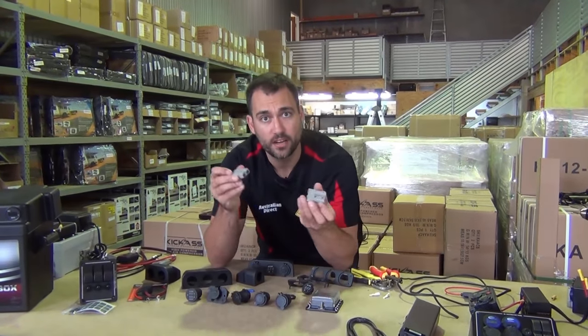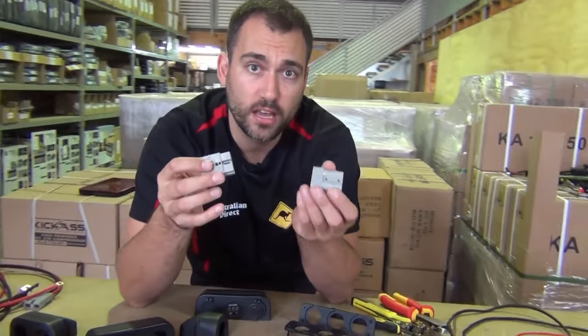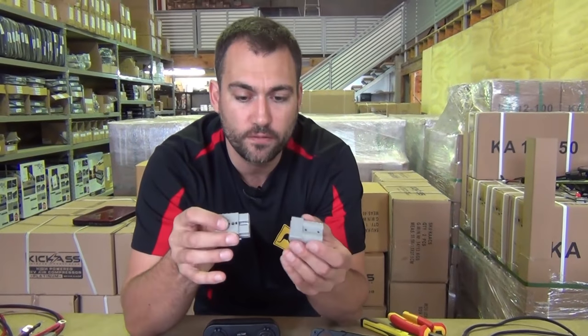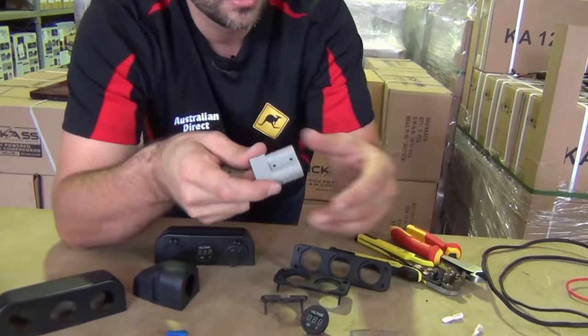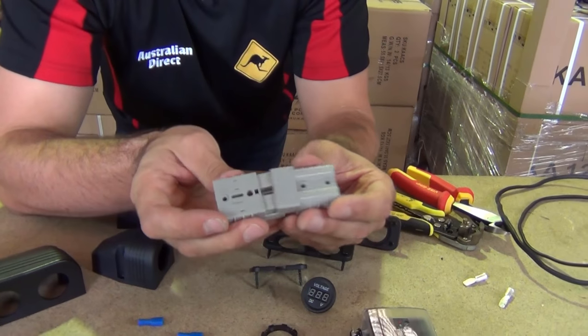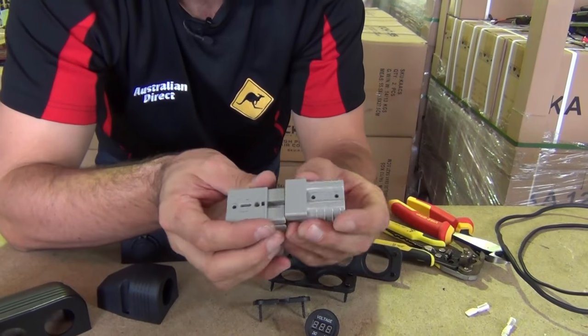I think all of you know Anderson plugs. Anderson plugs are my favorite connector in the world, and there's no male, there's no female, they just plug together. Okay, so you put your connector into your little terminals, clip them in, and you'll see them all over the website. So we sell them separately, and it's more for high powered situations where you want it up to 50 amps.